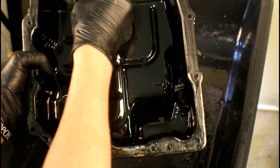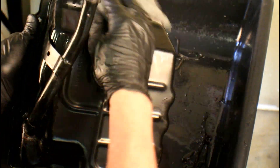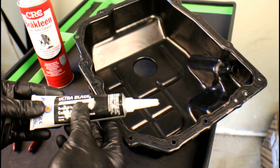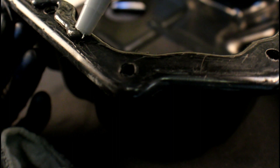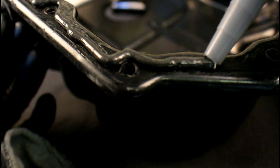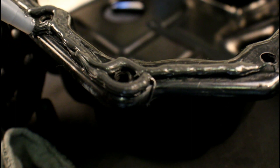Go ahead and grab your rag and wipe down all the excess brake cleaner, getting the puddles out of the way — this way it will evaporate faster. Once the surface has been wiped clean, we're ready for the RTV. Find a starting point and go around the edge giving it a nice bead. When you come to a circle where a bolt hole is, continue around and come back to fill that gap in. Keep one nice continuous bead all the way around, then come back and fill in the gaps.